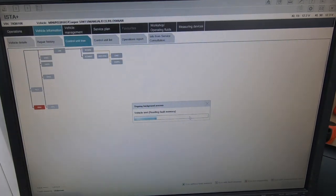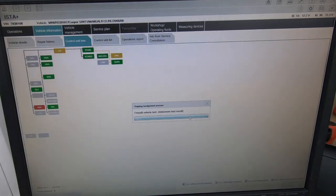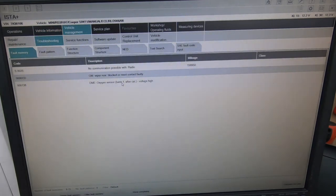The radio is showing red because the radio has been changed - that's normal, same as BMW. There's also EWS, which is the main key module - I can make keys for that module as well if you have worn keys for your Mini. The GM is yellow because someone didn't remove the rear wiper on this car, so it's showing as yellow because the rear wiper was deleted. Let's go into 'Display Full Memory' - and as you'll see, the oxygen sensor is the fault, as I mentioned in a previous video.